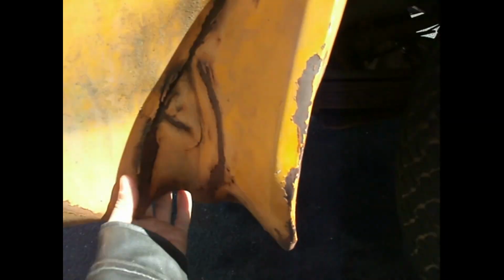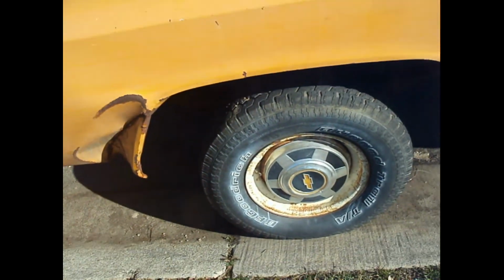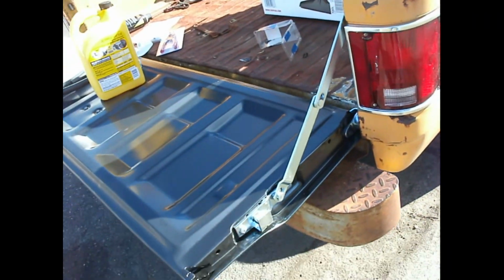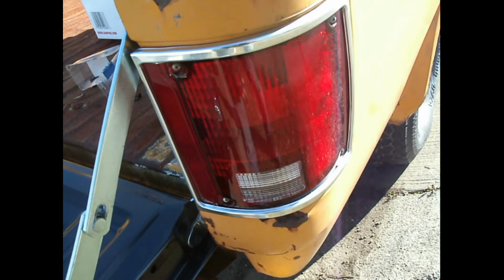And then one of the other repairs I'm gonna have to do is this. I'm gonna have to get into this and really do some hammering. This is gonna take heat, and a lot of hammer and dolly work to put that back into shape. But that's relatively easy. I got that kind of back in shape, then I can just lay sheet metal in there and tack it. Here's a spot. They actually sell these. So I'm wondering if I should just buy one and then splice it in here and then call it good. Which I just might do because all I need is this section. I could just literally cut here, here, and here and then put it in.